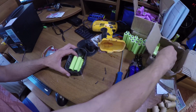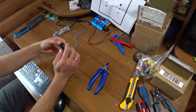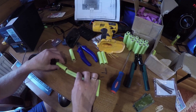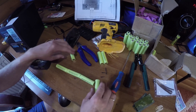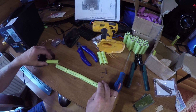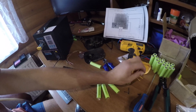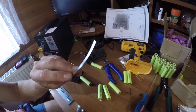Five pieces fit in. We also put here a BMS protective board, which protects the batteries from overcharging and deep discharge. Since the accumulator in the screwdriver was 18 volts, we will connect our new ones in series and get exactly 18 volts. Now you need to use spot welding to solder a nickel tape strip to each battery.